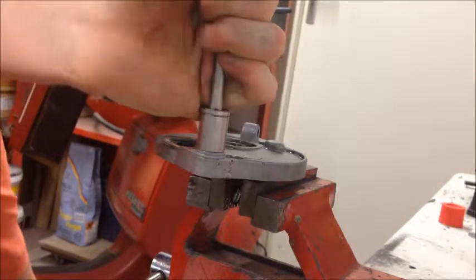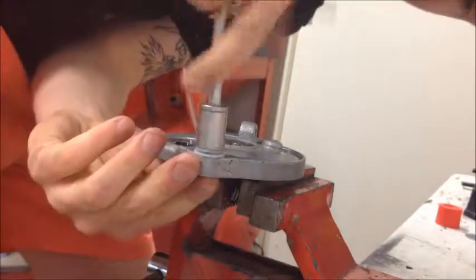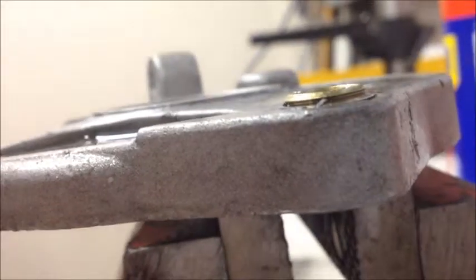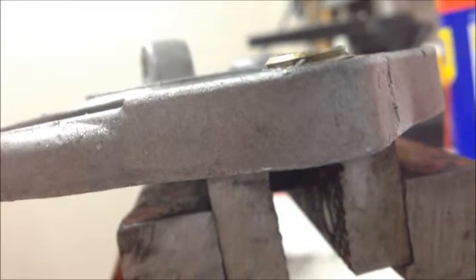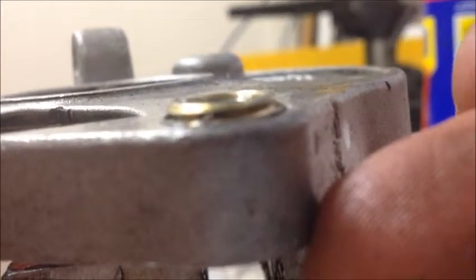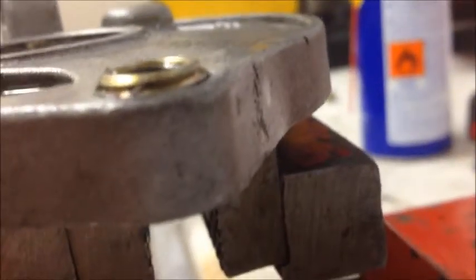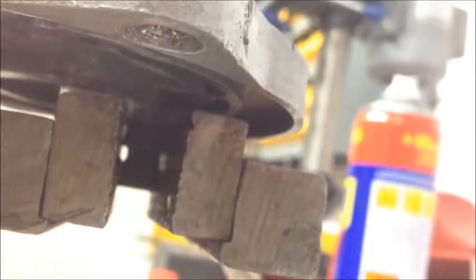One more tight spin. I think I can go in a little deeper — as you can see it's still sticking out the top a bit. I bought these inserts specifically because they were the same length as the brake plate thickness, about 12 millimeters. It's still sticking out from the top side. Not a problem — you could dremel that away or flatten it out. But I still have some space on the bottom, so I'm going to try to get it in one or two more millimeters.